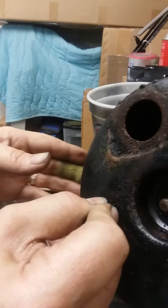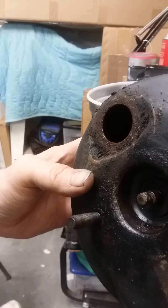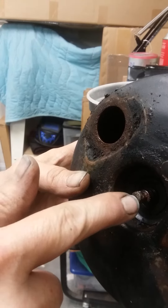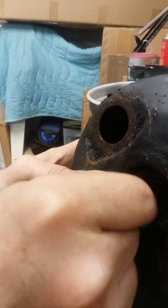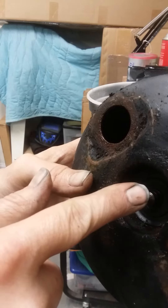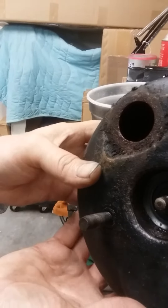The other reason I wanted to do this video is to talk about this adjustment screw. The Haynes manual has a specification — you have to screw it in and out to set it properly while the engine's running. I think it's supposed to be ten thousandths of an inch lower than flush. I'll cover that in another video.